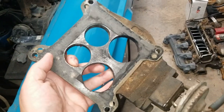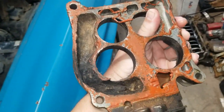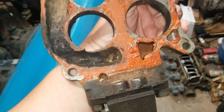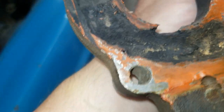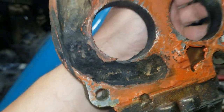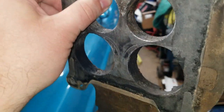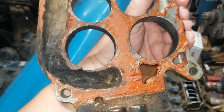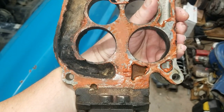This is the EGR plate that I pulled off of there. On the back side they had like a cardboard box cut for a gasket with all this crap on here, and you can see it's rotted. It was probably causing some of my weird engine sounds and rough running kind of stuff.